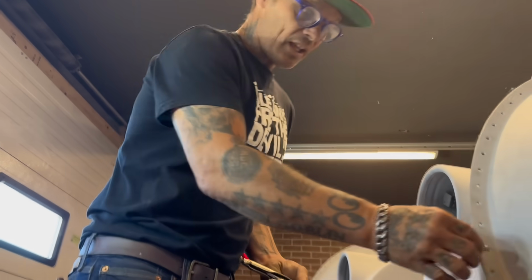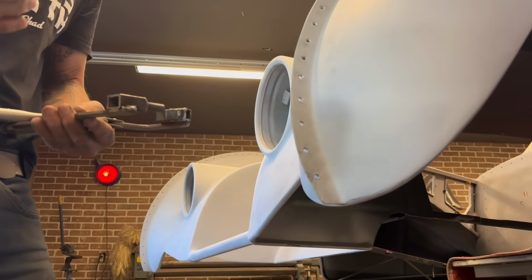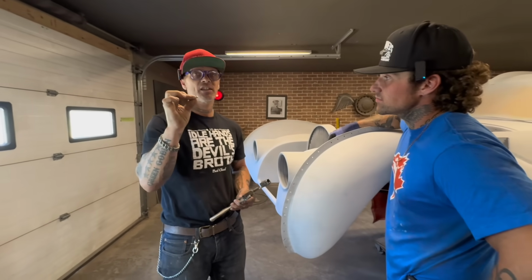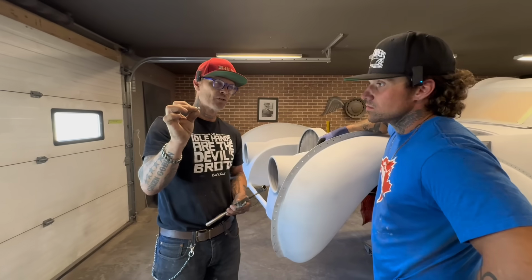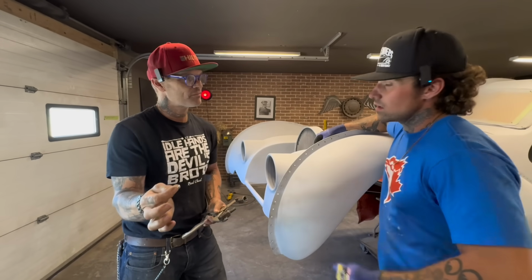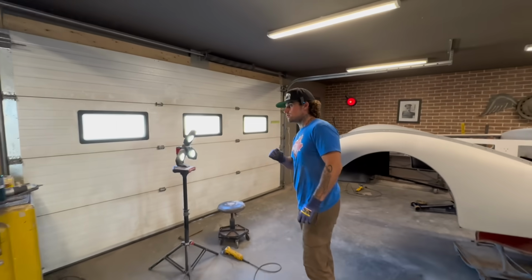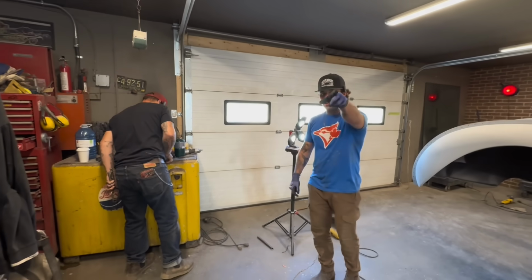But what happened yesterday is we had a conversation here, a couple of people stopped in, Dan the man was in, Brent was in, and we talked about the rivets. We could throw them into a pan and put them on the barbecue and get them heated up. The reason I'm saying that is because we heated one up with a torch, and it squeezed really easy. It got soft. I don't think aluminum holds heat that long, so it's a quick process. Very quick. That's how they used to do it.